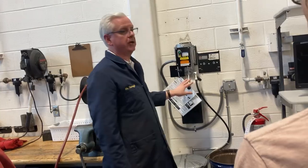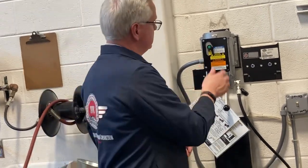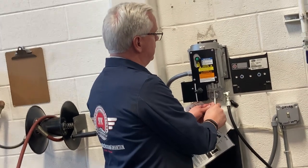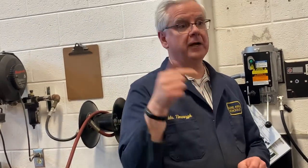Now lower the locks — just push the handle, that releases it. Now the nice thing about this new setup is, remember all the other in-ground ones, it's just push button up or down, right? So you can't control how fast it comes down. This one now you can, because it has just a mechanical handle pushing on this valve to release it to come down. So if you want to come down really slow, to put it on one of our big jack stands or something because you're trying to push something together, now you have real control over it. Where before it's just up or down, which I never was really fond of that anyway.